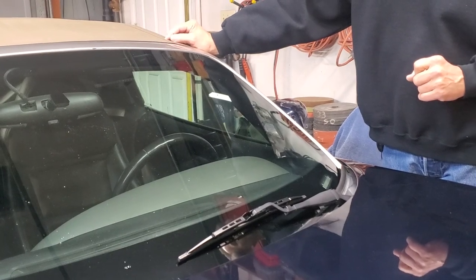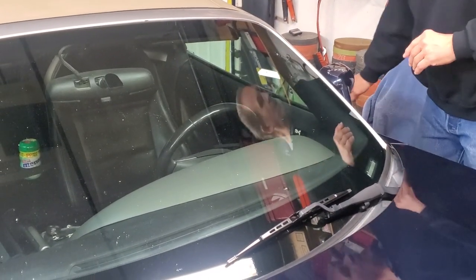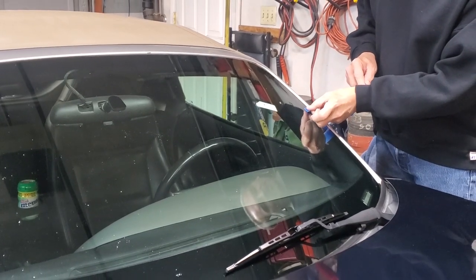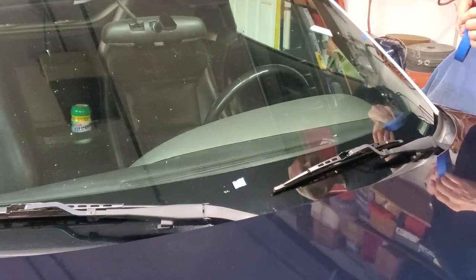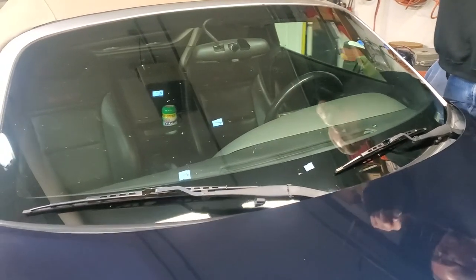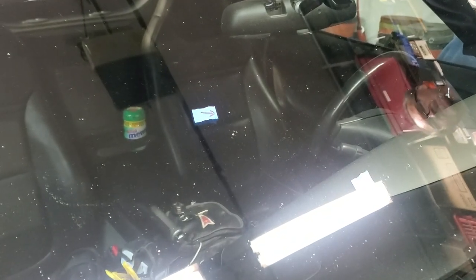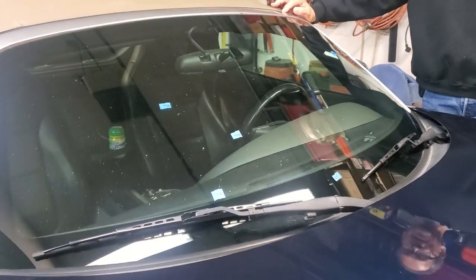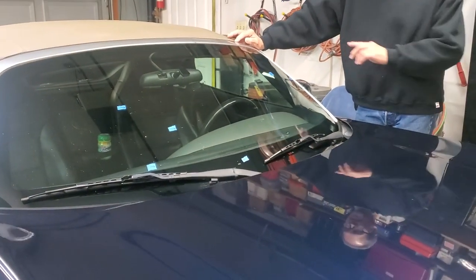The little white sticker we put on here is just a label on the back of the window so that you can actually see one of the cracks easily — it's hard to focus on otherwise. I've also got some blue tape to mark other locations where there are cracks. I've gone through and marked one, two, three, four, five, six really bad cracks in this windshield, all caused by rock or road debris. You may also notice all kinds of little white specks — those are tiny chips caused by rocks and road debris. As I said, this is probably a great candidate to replace the whole windshield, but because it's a commuter car, we're going to continue using this windshield and fix these particular cracks.